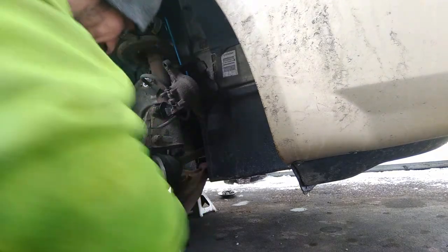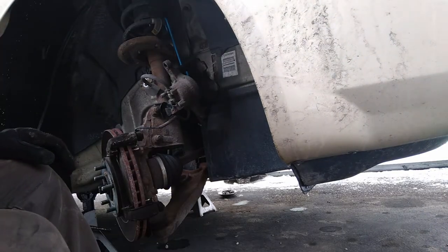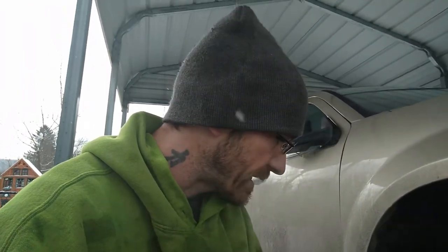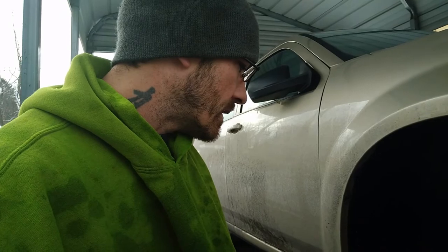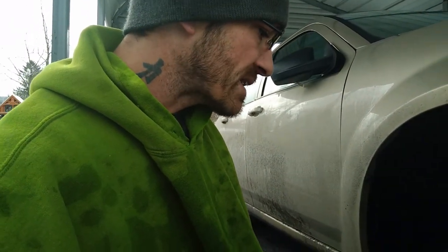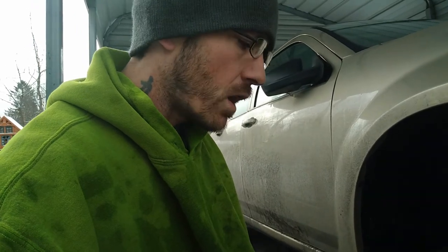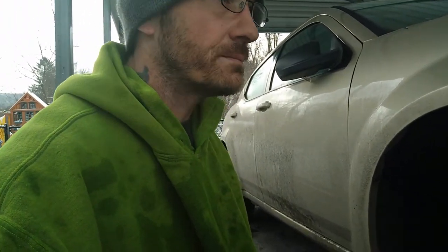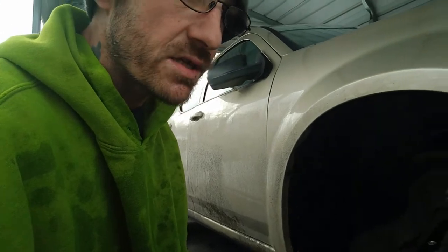Now these brake pads are actually in really decent condition, but the customer complaint is a lot of noise while braking, and a lot of pedal shake. He wanted to change the rotors, so I told him that I wouldn't just swap the rotors out. He needed to swap the pads as well, because they develop a wear pattern, and you don't want to have the same condition because the brake pads have worn to these warped rotors. So that's why we're changing the brakes.